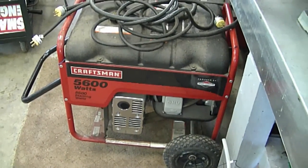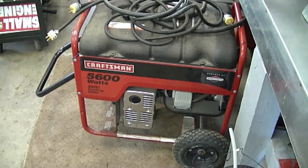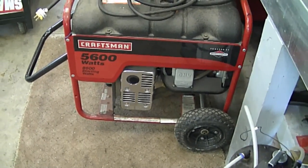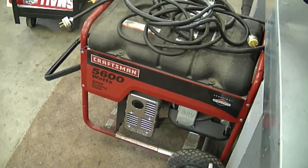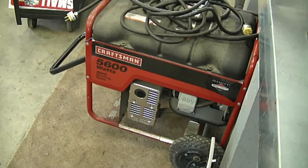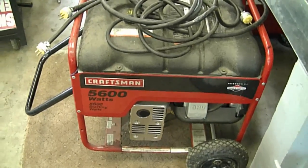On the upside, if you're going to leave your generator stationary at home and have a second one for mobile purposes, that's awesome because you'll never run out of fuel. The only time you'd run out of natural gas is if there was an earthquake and the pipes broke in the ground. Another plus side of natural gas is it burns a lot cleaner — the plugs will not get dirty, the engine will stay a lot cleaner inside, and the fumes aren't as toxic as gasoline.